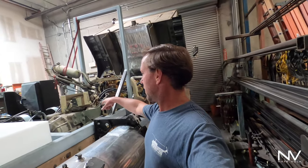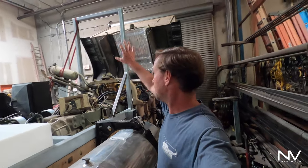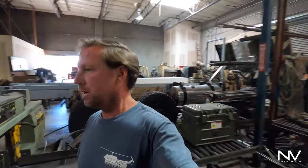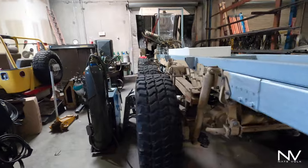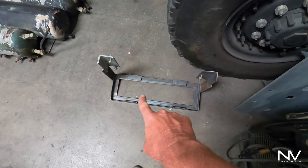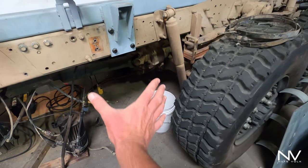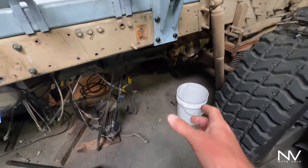The ABS computer and polarity protection box are all going to get mounted to that headache rack somewhere soon. I'm putting my batteries in — I'll walk over and show you those. I'm only going to run two batteries for the starter, I don't really need anything more. This is my battery dock, so I've got two batteries in there with the hold-down clamps, and that is going to mount in this area inside the spare tire in the frame so I can get the batteries out the back pretty easily.